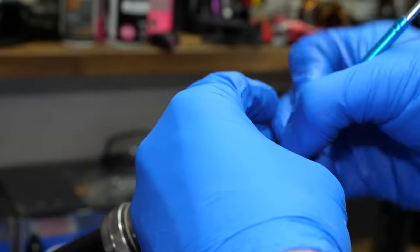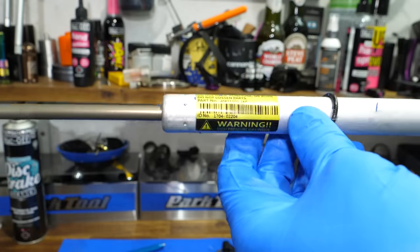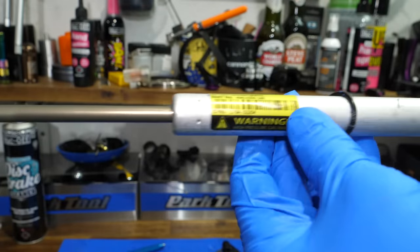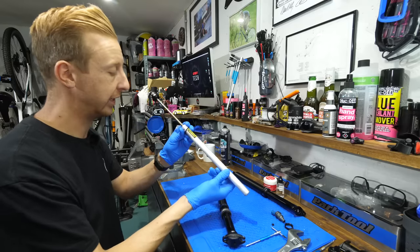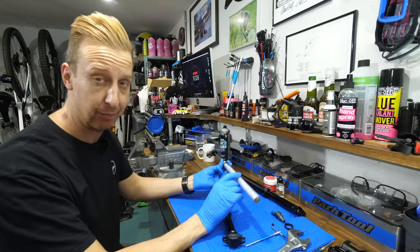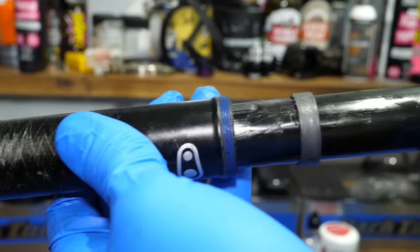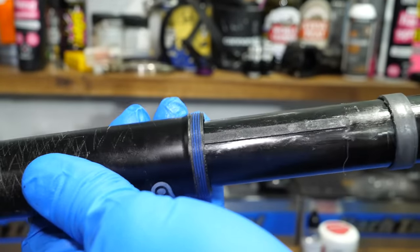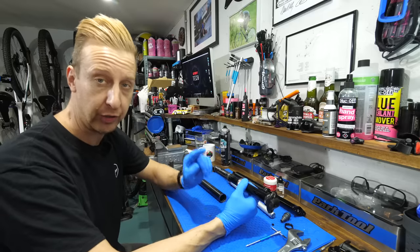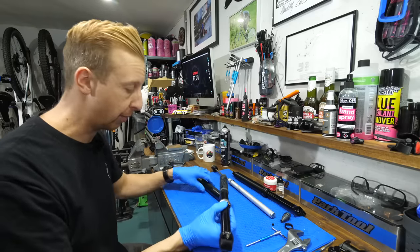To release the cartridge from the system, in this case it's a 2.5 mm Allen key on the top. Then it should just slide straight out. Remember I said it looks a little bit like those gas struts you get on your car? Same thing — this one says WinTech Suspension: do not open, puncture, or burn; do not loosen parts; high pressure gas inside. If this fails, you can simply replace this part. When you slide this open, you can see that's why it's running so badly — because of that gunk that gets in there. If you only do option one — just putting a bit of oil down the top — eventually it's all going to gunk up like this. This is why you should be pulling it apart to clean it.